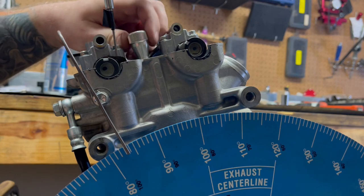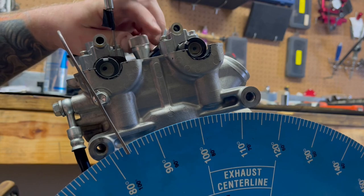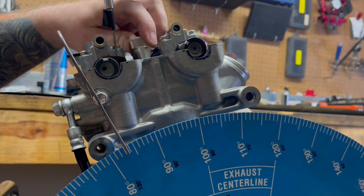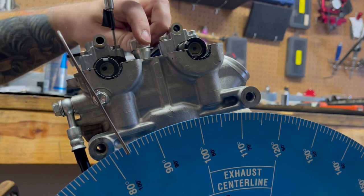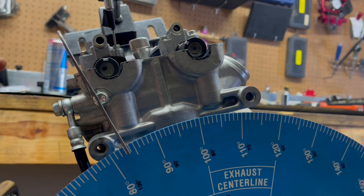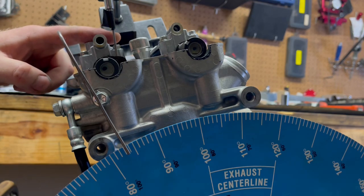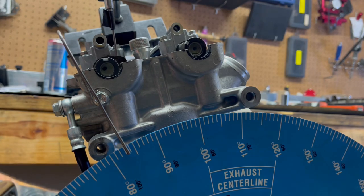A trick I found with these: screw them in all the way tight until they bottom out. And then take about a quarter turn back. What that does is, if you screw it down all the way it acts like a spark plug and holds compression. You'll see a lot of times when the wheel's coming around, if you haven't backed it off, it'll get to the pointer and as soon as you let it off it'll back off like a degree, sometimes two degrees, depending on how much compression you've got in your cylinder. You'll possibly hear a little bit of hissing. So we'll go ahead and run it until it stops and see what the reading is.